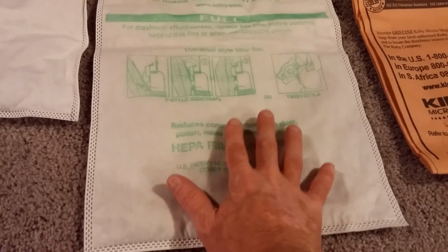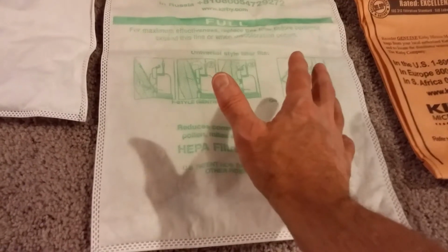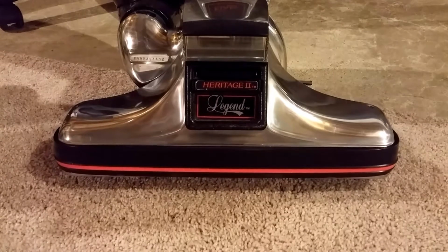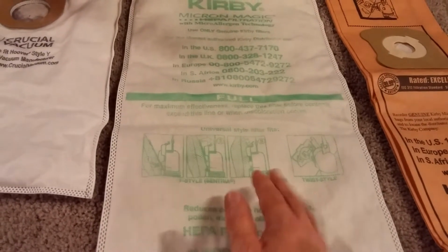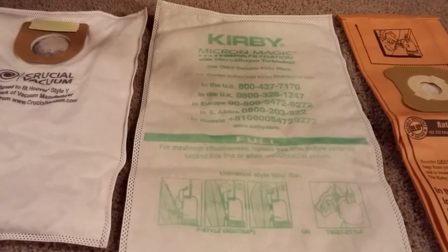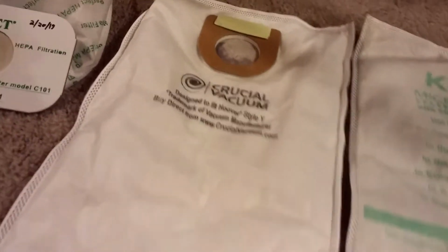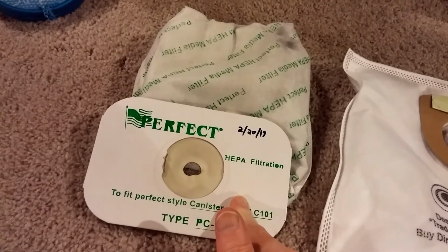Now you've got to remember, a Kirby runs in the hundreds of CFM. Well, 100 plus, not like 200 or anything like that. They're in the 100 plus mark. So if you have a nozzle like this, and it's running, say, 120 CFM to start, and with a full bag you drop 20 CFM, you still have 100 CFM left. And that's more than a Hoover Tempo Wide Path starts with, and certainly it's way more than what an Electrolux Olympia 1 can possibly do.